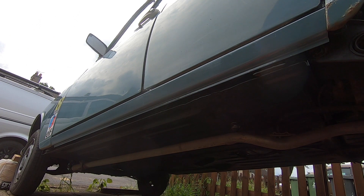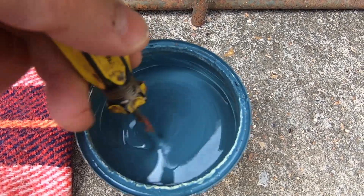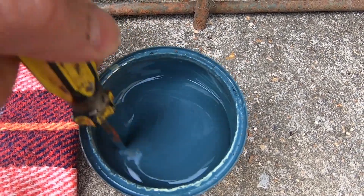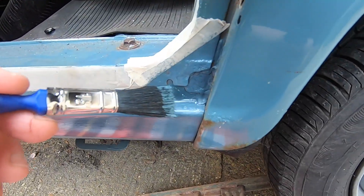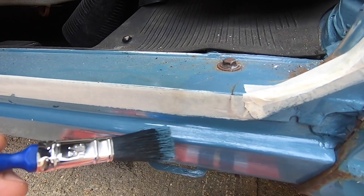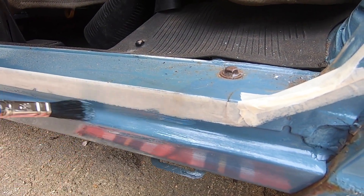I've taken the time to rub down and prepare these sill panels. They weren't too bad, just a little bit of flaky paint where they were never painted properly when they were attached to the car. So I've painted those with some brushing paint - I'll show you the tin. I quite like the brushing paint for this. It's not too bad; obviously it's not a spray finish, but none of the car is really a spray finish - it's just paint at various stages of flaking off.